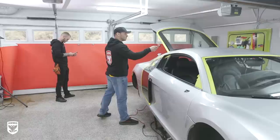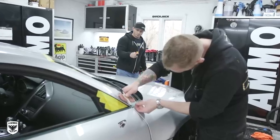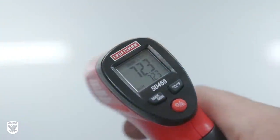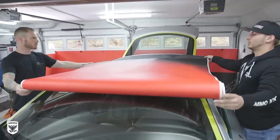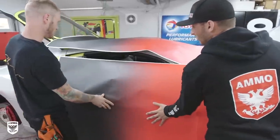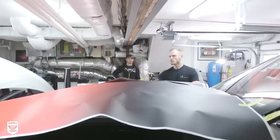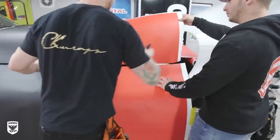Knifeless tape was pre-placed along the window seams while we waited for the garage to warm up to 68–72°F for optimal installation. In hindsight, I should have washed the car with warm water to avoid a temperature drop, but lesson learned. Once up to temp, Christian used compressed air one last time before taping the wrapped pieces into place. Each piece had to be carefully measured — unlike a straight color change, here each piece was measured, placed, checked, double-checked, taped, moved, and re-taped until he was a thousand percent satisfied.